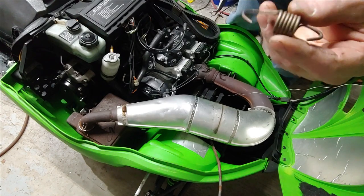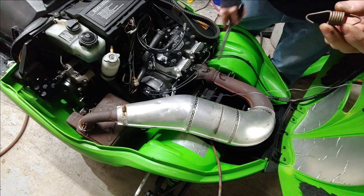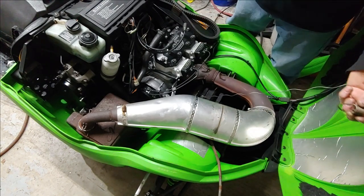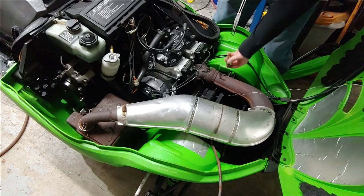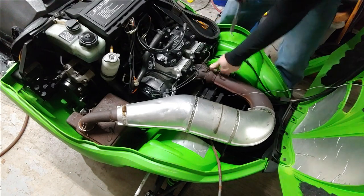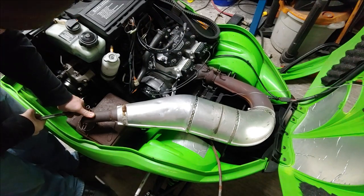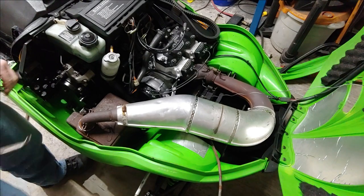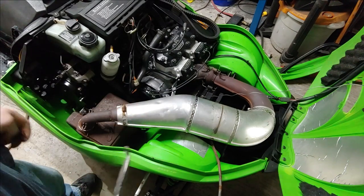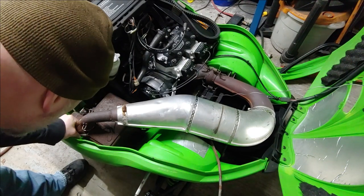And like I said before, you want to hook the back side first and then put it over the engine side. What that'll do is ensure that if it does slip off, it goes shooting towards the front of the sled, and not into the belly pan under the engine compartment. And you want to make sure that you're not pulling up with both hands, because if it pops off, you don't want to pop yourself in the face. You shouldn't be that close to it to begin with, but you're better off using leverage from your thumb or something.